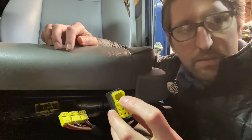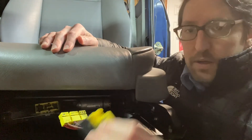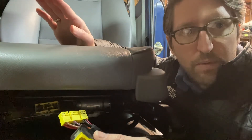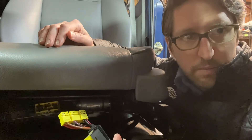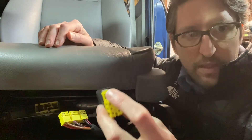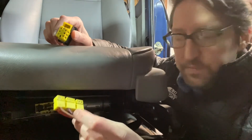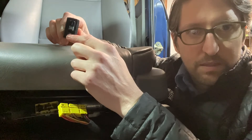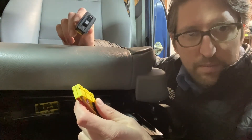Back to the pins — on the back there are six pins. Pin one you're going to wire to an illumination source, so whenever you turn the lights on the rig, the little seat icon will light up, which is really nice at night. Pin two goes to the NTC signal — that's the negative thermal coefficient sensor. You wire pin two to terminal 23 on your seat, which is a resistor that as the seats heat up, the resistance changes in the circuit. That tells the switch whether the seat is not hot enough or at the right setting, and then it'll turn off heat so it doesn't get too hot. I really liked using the BMW switches with the seats for that reason — it's a system and it works together.